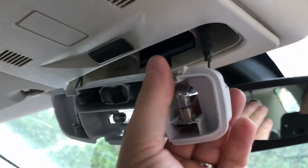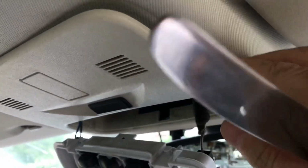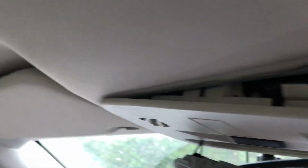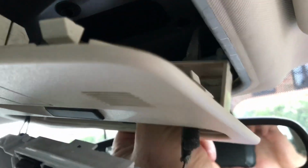So you want to try to pull this down, leaving the metal ring behind, by pulling this light bulb holder bit down here. Now you can use something like a dinner knife to get in here and pop those. You see there, you can just see a little barbed plastic clip. There's more at the back. There's one at the back. Some of them are one way round, and then others are that way round. I think that's so that when you refit, you locate the back first, and then you pop the front and sides in. As well as that, if I just pull this down, you see there, there are some plastic pegs that go into those holes up above in the metalwork, and they are hard to remove.